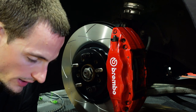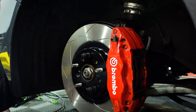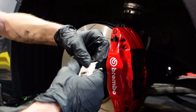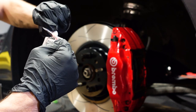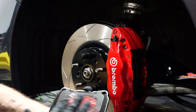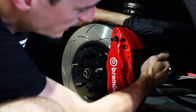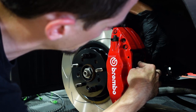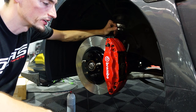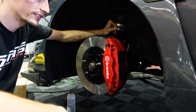Now all we're going to do is try to slide our pads in there, and that should be pretty simple. We're going to put a little bit of red grease on the backside of the pad, slide them both in, and then reinstall our pins and clips. It comes with high-temp grease, which is good because I thought I was going to have to order some from Brembo. You don't need a whole lot — just put a little bit on the backside, spread it around, set the pad back on top, and start to slide the pins through.